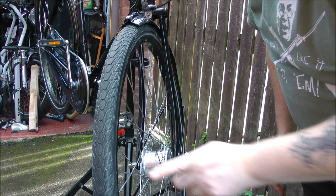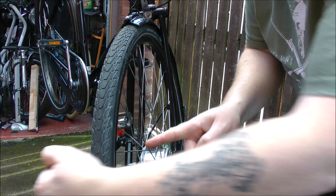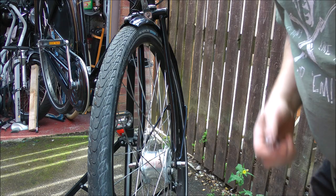Now really of course you should remove the tyre — then you're making sure none of the spokes protrude through the rim tape and into the inner tube. But I'm a big boy, I take my own risks; I'm not saying you should — only you can make that decision. Also ideally you need a truing stand with little pointers that go either side of the rim so you can physically see or hear it when they're touching. That's the ideal if you're building a lot of rims and doing a lot of wheel truing.